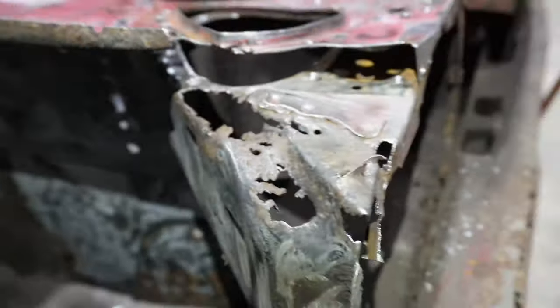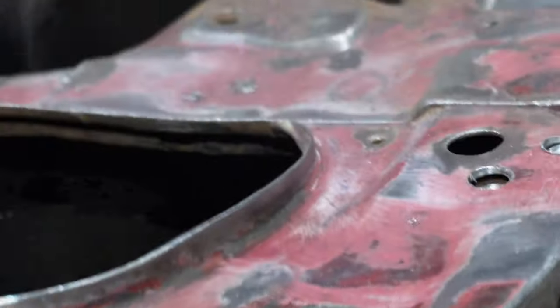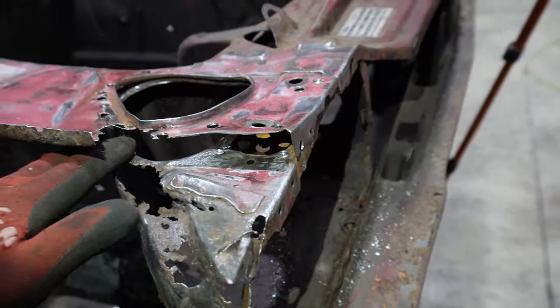So it's cleaned up quite nicely in there, it's actually good solid steel. Same within there. A wee bit of surface, so I'm going to clean all that up in there, and we'll probably put a coat of copper weld through primer in between the two skins just before I spot weld it all back together.